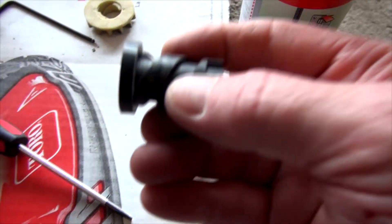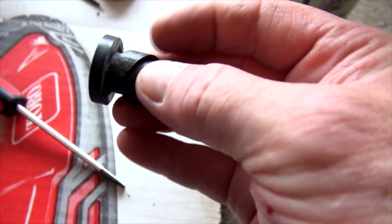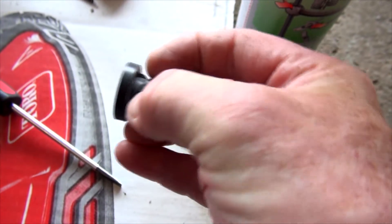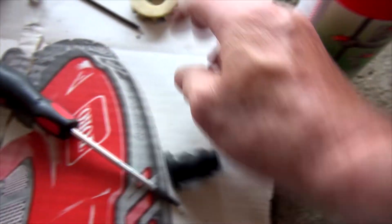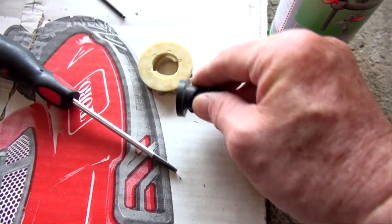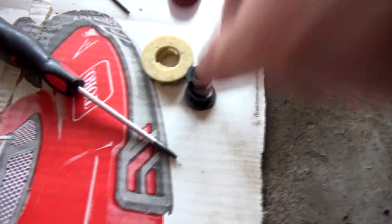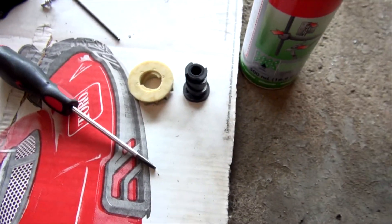I filed those nubs off — there were two little nubs, one on each side. You can see what's left of one there. It's probably from the molding process and they weren't completely filed off — they were a bit rough. So this gear was sticking in the wrong place, and when you went to activate it, it would stick and blow the fuse. Let's lubricate these, put it back together, and see how it works.